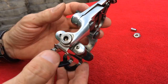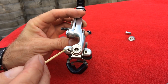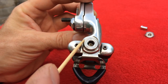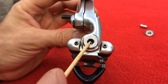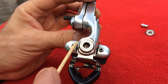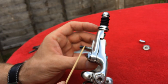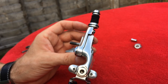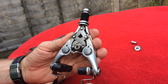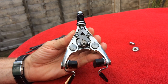I'm using 25mm size tires with these brakes. So you can adjust height here. Another adjustment point is that you can also move the brake pads up and down - you just loosen this bolt and adjust the height of the brake pads. That's the first point of regulation for height, and this is the second.